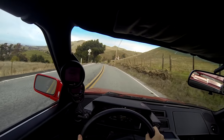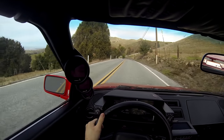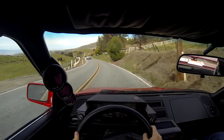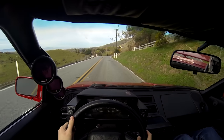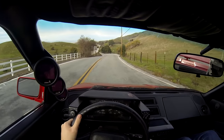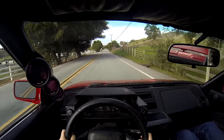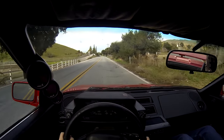In terms of chassis performance, I think there are two areas where this car could use improvement. The first is the suspension — for street use, it's just a little bit too bumpy and stiff. On a much smoother track surface, this suspension setup would probably do excellent. But for street use, it doesn't handle the road imperfections all that well. And the steering, especially with this quicker steering ratio, tends to follow the grooves and the bumps. So it does make it a little bit hairy to drive at the limit.